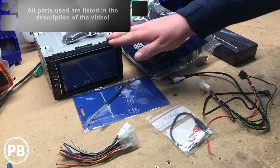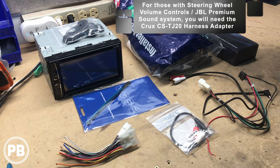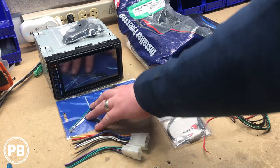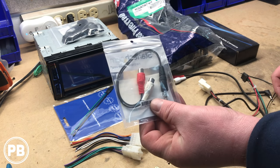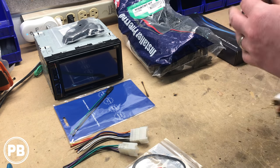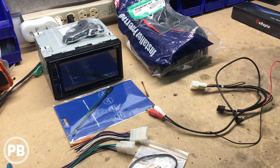Some of the parts we're going to need: first, our double-DIN Pioneer — the Pioneer AVH-201EX. We're using this dash kit, the American International Mounting Kit for double-DINs, the TOI-X-994. We're using a METRA wiring harness with micro-bypass for options and video playback while in motion. We also picked up an AUX to female RCA adapter because we're going to retain the factory AUX input using a generic harness from METRA. That other harness also does steering wheel controls, which we're not supporting here. In a separate video we're going to be doing a backup camera as well — we'll throw a link in the description once that video becomes available.